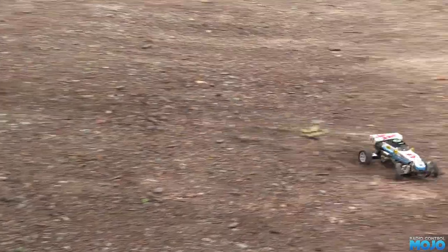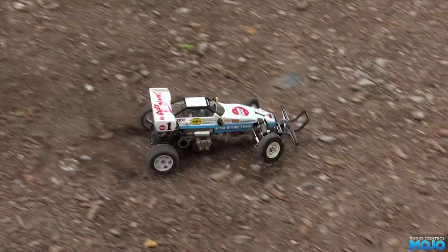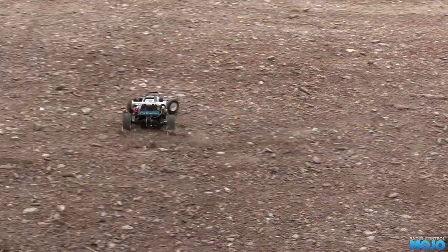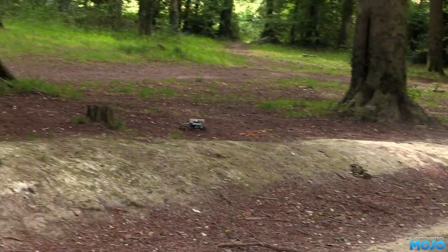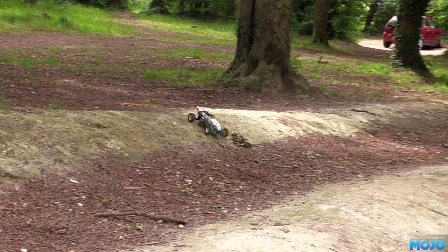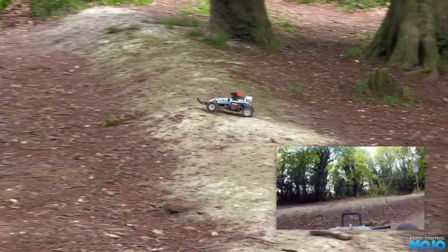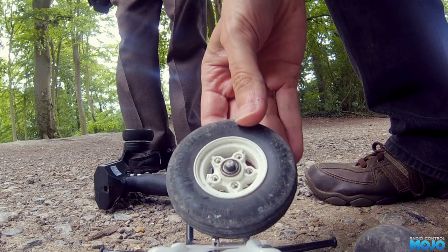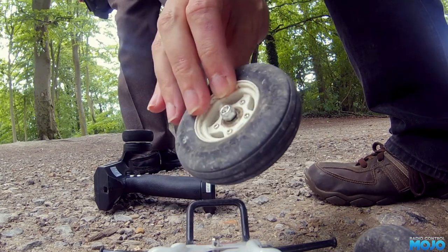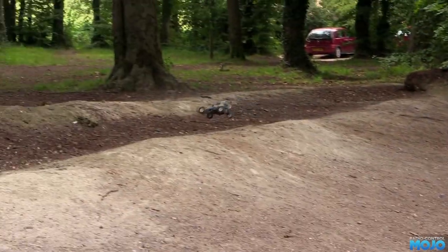Time for a test. The plan was to run around the loose dirt for a bit, get some videos sliding around doing some jumps and skids. I was also going to do a bit of bombing around at a skate park, but there were lots of kids off school and it was full of kamikaze scooters, so trying to film would have been a bit of a faff. On the dirt, the new tyres really aren't much worse than the stock spiky ones — if anything, they might be just slightly better. I'm guessing on grass though, they're going to be pretty terrible. Just before packing up in the woods, I decided to pop the run cam on the roof and get a bit of onboard video. Literally after just a couple of jumps, the wheel fell off. It doesn't look like it's broken as such — the stub axle has pulled out of the upright. It's got a spline on the end, but as far as I can see it's just a press fit, which really isn't brilliant. Still, it gives us something to try and fix next time. It's possible on one of the not so good landings it distorted something, but we'll see in another video — we might end up just having to replace it.